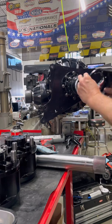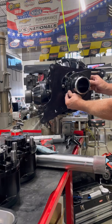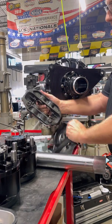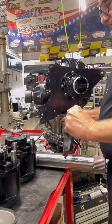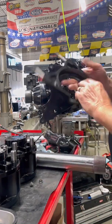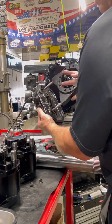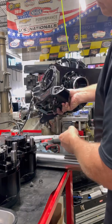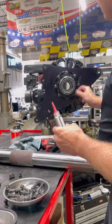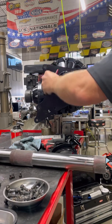Next we're going to add the brake caliper brackets. We use PFC brakes, and they're the only brake in top fuel that actually mounts like this — they call this a radial mount. It's kind of like a main cap on a block. It has studs that stick straight out from the mounting bracket, 90 degrees to the caliper, and it bolts on from the back end side instead of the side of the bracket. When it's on the side, that bracket can flex one way or another.